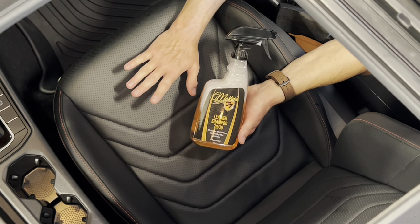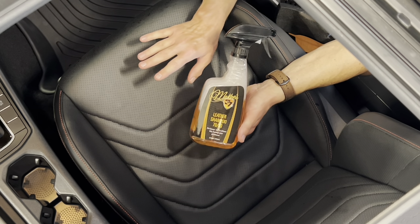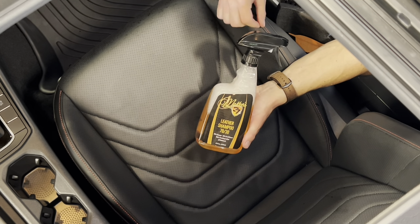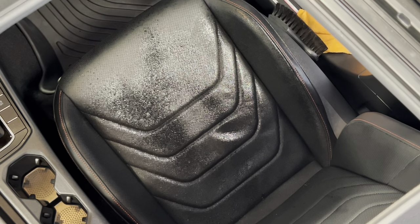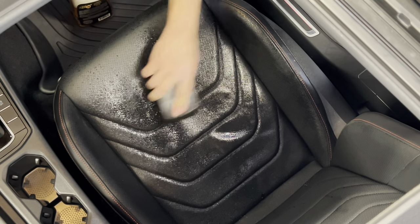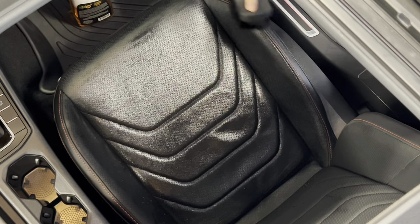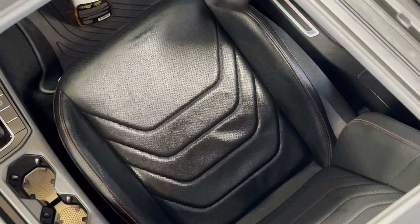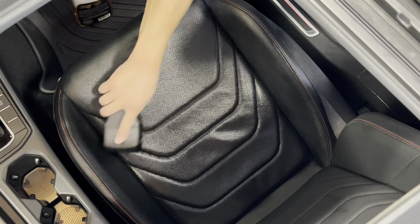Use high-quality products because what's more expensive than a bottle of leather cleaner is a new leather seat. A lot of guys will tell you to use an all-purpose cleaner — yes, it'll work, but in the long run if not used properly it will be detrimental to the material, causing delamination and stitching degradation. That's not an issue with leather shampoo. Spray the cleaner on the material, spray some directly into the brush, and then agitate. This brush is safe for leather, designed specifically for it, won't damage the stitching or perforated sections, and the tightly-packed bristles are soft yet still effective for scrubbing.